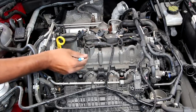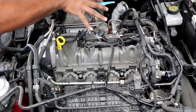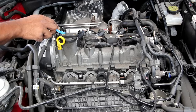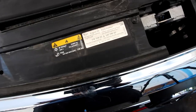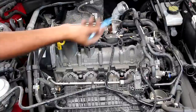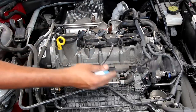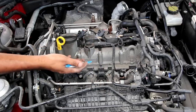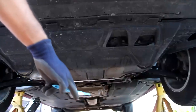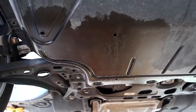Taking a look at the top of the engine you can see we have this metal cover. Now this isn't exactly a valve cover because it doesn't only just cover the valve — it's actually a camshaft housing. So when you take off this camshaft cover, the camshafts themselves actually come up with it as an assembly as well as a bunch of other components. On the top of the engine we've got the oil filler which takes commonly found 0W-20 weight oil and a physical dipstick — not a sensor. Spark plug access is pretty easy; it's just behind these four ignition coils located right on top of the engine — there wasn't even an engine cover here. Also on the top here we have the PCV valve which vents directly into the air intake, and down below we do have an oil separator which forms the complete PCV system. Taking a look at the underbody of the Jetta you can see that everything is fully covered with plastic and it's flat — with the exception of just a center muffler — and that's great because it's going to protect it against saltwater corrosion and it's good for aerodynamics.